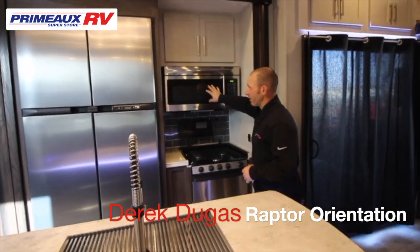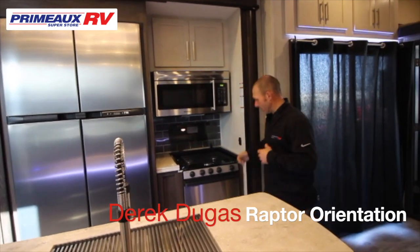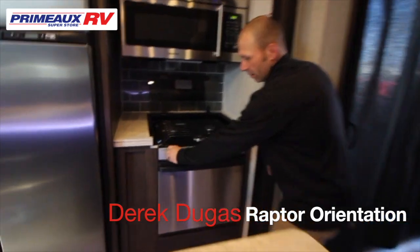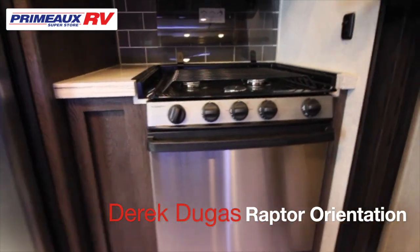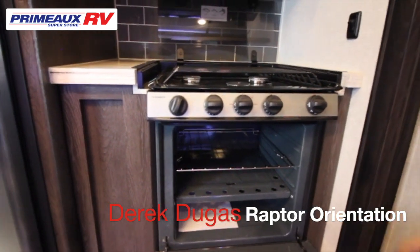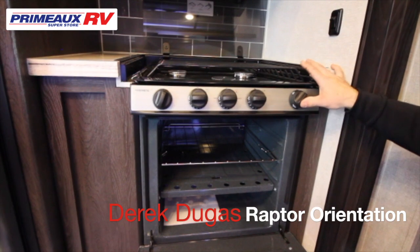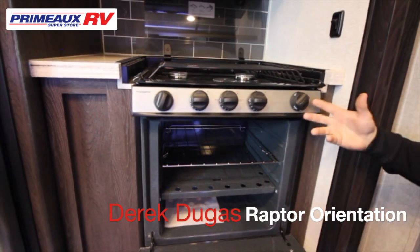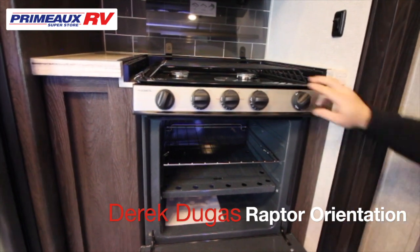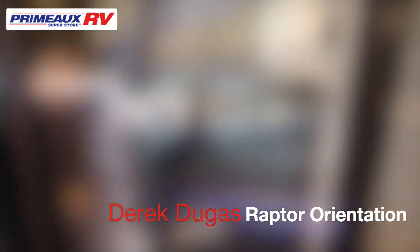Here we're going to have a convection oven in this model, so you can actually bake with this. The stove, you're just going to pick which burner you want. Turn the spark and it will light for you. On here, the oven is still manual. You're going to have to put your lighter down here, light it, put it on pilot, press and hold it. Once it lights, hold it for 10 seconds, and then go to the desired temperature. Just make sure you turn it off when you're done. If not, the pilot light will stay lit.